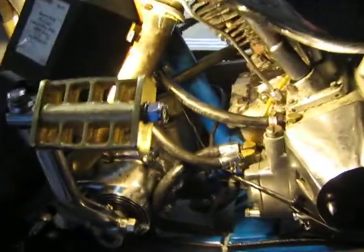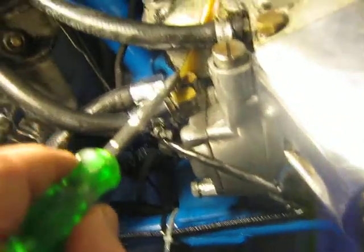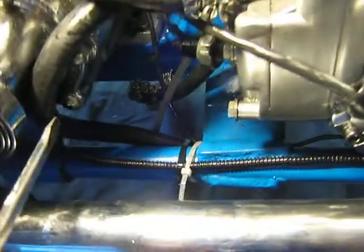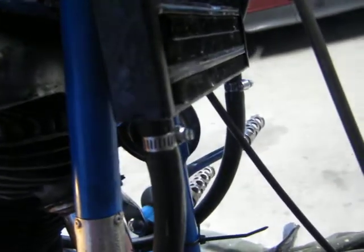I'll just go through the work I've just done. I started from here, the inner point of the oil pump, and I've gone down without kinking it — I've kept a round circle for the flow of oil through. I've decided to go underneath the frame and I've connected it here. It curls up around the frame. I've connected it there with a plastic tie, a third plastic tie. And then at the oil cooler, I've connected it with a clamp.